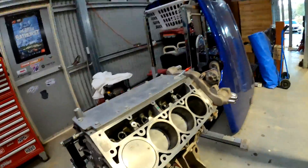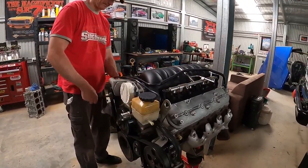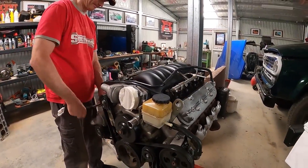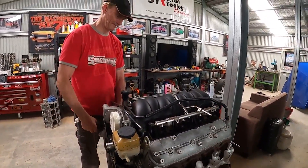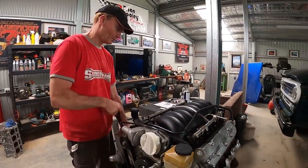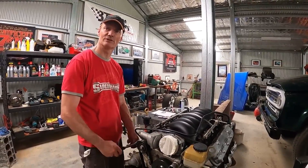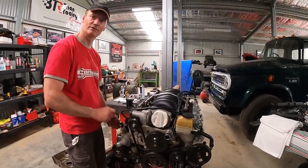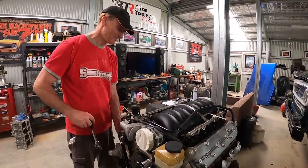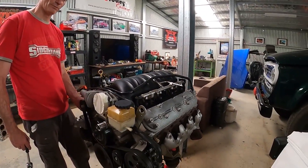We're pretty excited. We thought we'd take you back in time a little bit to when we actually took the other heads off, so you can see the disassembly procedure and what it looked like. Everyone's probably seen our L77 that we got out of a written-off VE — this is for our ute as well. We've got a few updates. Starting with the heads: we've got to whip these heads off and get them down to Higgins in Melbourne. We're going to do some CNC porting, lap our valves in, and get some valve springs that'll cope with 600-thou lift camshafts. So that's a bit of fun — they should come back all nice and shiny and perform a little better.